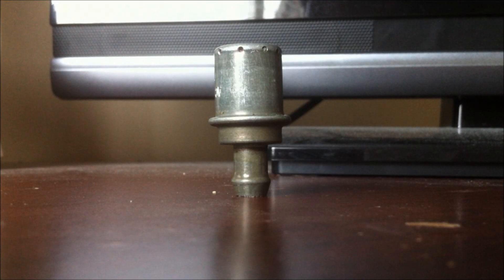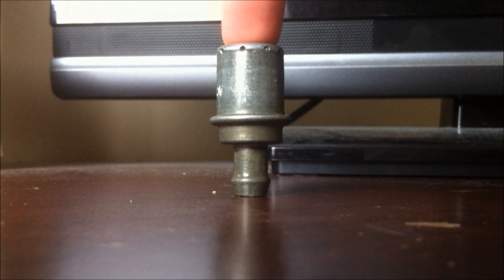There is also another test you can do while the engine is running. Place your finger over the bottom of the PCV valve — there should be suction. If there is no suction, your hose may be plugged. If there is still no suction, then your valve has to be replaced.